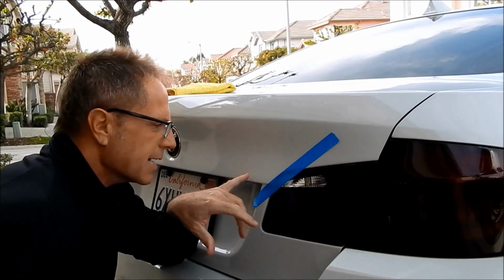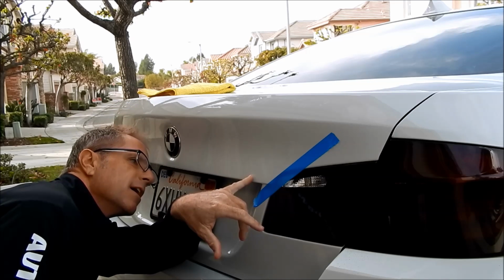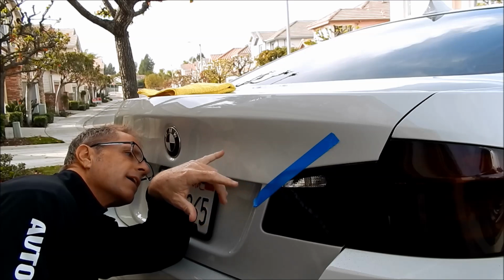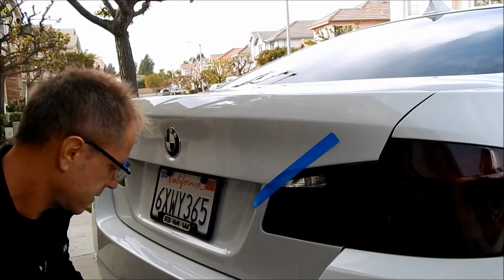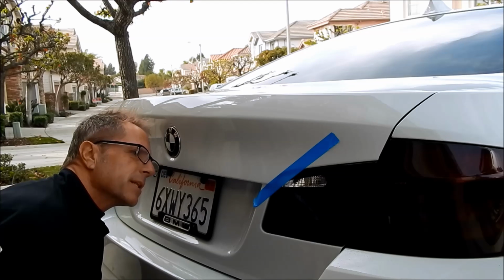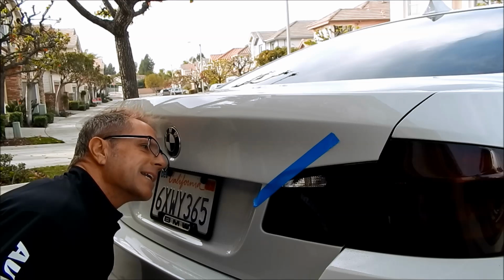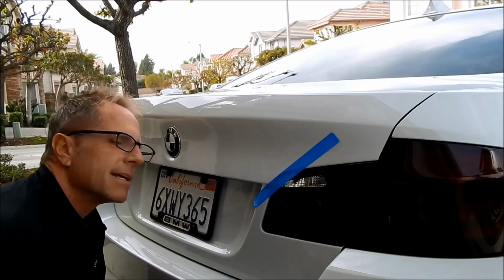And this is where these glasses really come in handy because I can really scrutinize this to a much higher level and see what's going on, because I know that if I can nail it under this close scrutiny, it's going to be perfect with the unaided visual eye. Remove the polish, check for results, either move forward or determine that you are done. And based on what I'm seeing with my magnifiers, I cannot see any blemish whatsoever. So I'm going to call that a level 10.